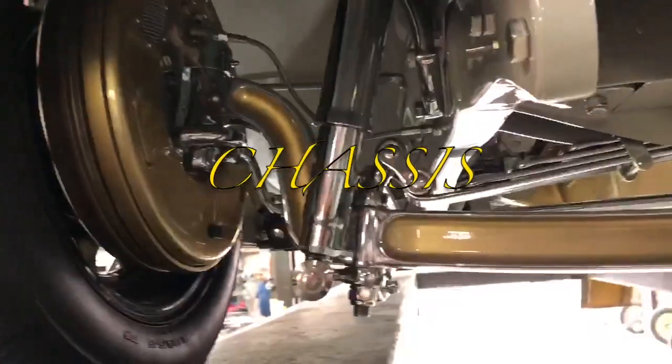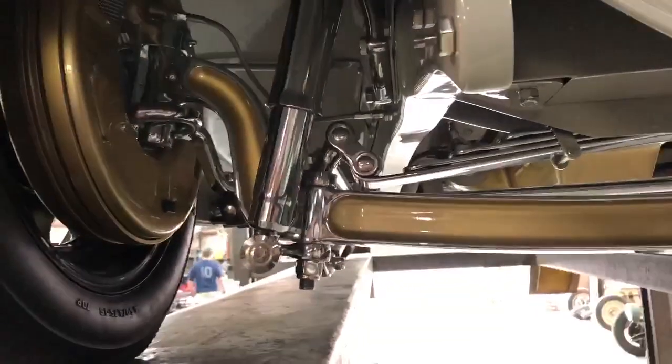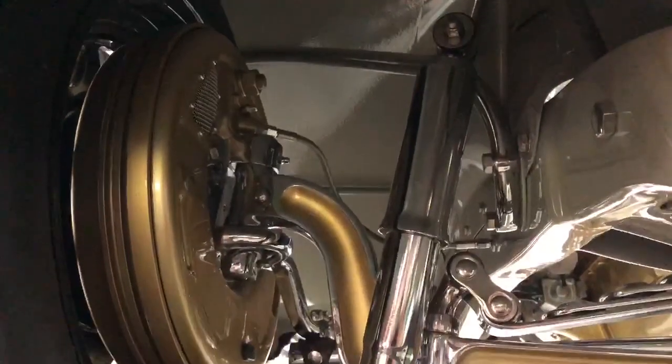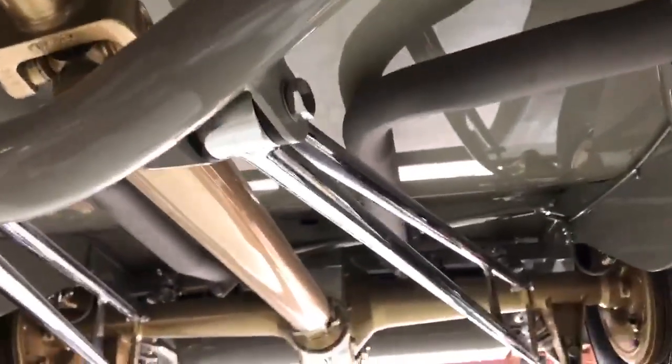We're going to go over the chassis on Brandy's car. Up front we've got a 5-inch SoCal Drop I-beam axle and Bowling Brothers brakes. We made custom fender braces to get the car to sit lower. We're also running a custom set of hairpins — all custom made, real cool looking stuff — same way on the high-rod drag links. Started out with a set of American Stamping rails, fully boxed in our jigs here at the shop by Dennis Elmore. Made some custom covers to clean up the bottom and got a one-piece floor pan underneath the car to clean it up real nice.